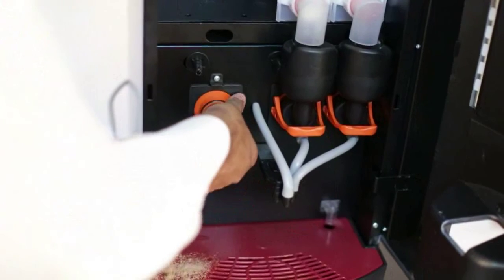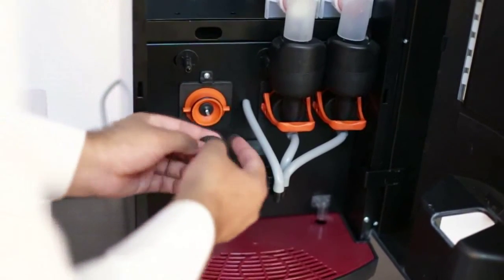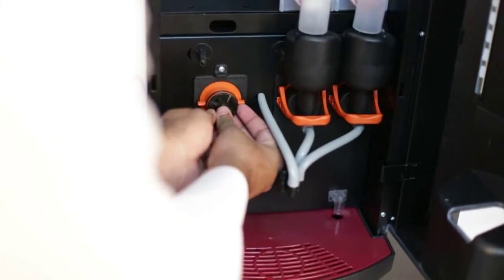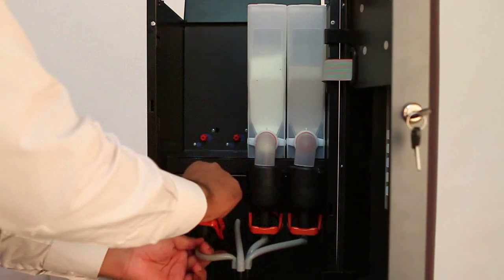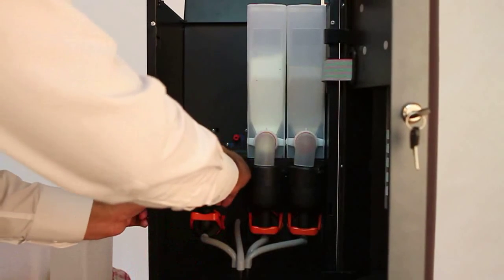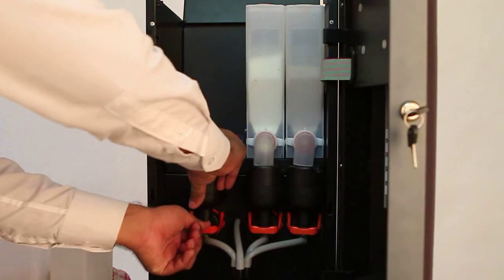Once the cleaning is done, fit the whipper chamber and then the blender back. You will need to match the cut of the whipper motor shaft and the blender. Now again connect the silicone tube onto the dispense outlet. Place the funnel back to the whipper chamber and align its position with the water inlet pipe. Lock the funnel by pushing the funnel lock downwards.